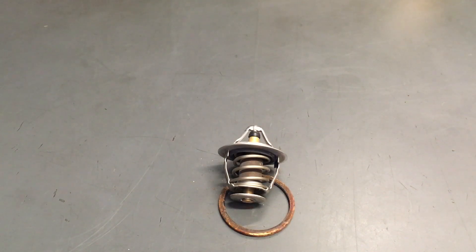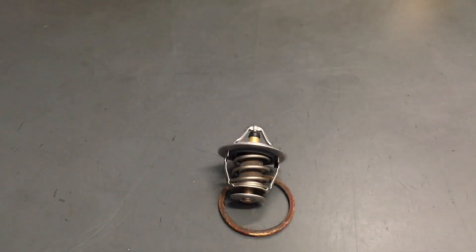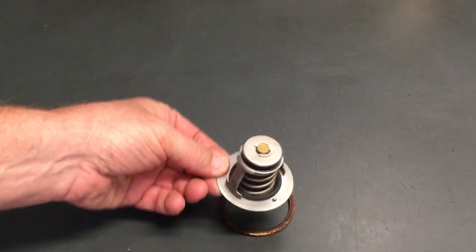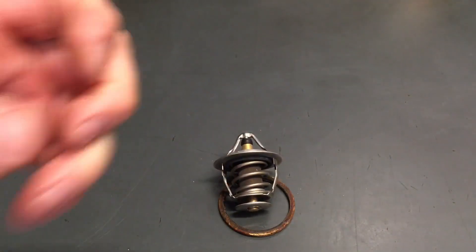That's how I roll — we look at what's normal on all these vehicles, and if yours is doing something that's not normal, get rid of it. I'm not telling you all to go replace your thermostat; most of them I've seen maybe one or two a year that are not on 83. But when you've got a problem you'll know — you'll see it on 78 staying there, or 87 or 88 just staying there. It doesn't necessarily mean it's the thermostat, but it probably is.